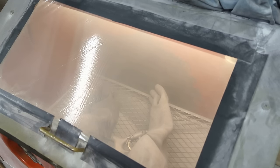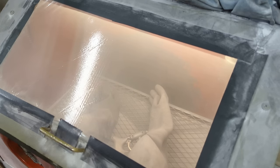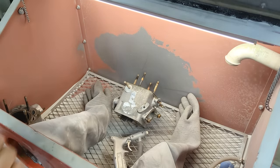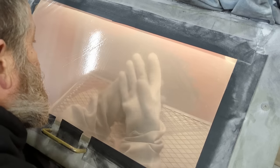After parts washing, I wash them with water. I'm fortunate enough to have a bathroom in my shop so I just go to my laundry sink and rinse everything off. It's best to rinse the parts washing solvent off all your parts — it can leave a residue and cause issues. I rinse everything with water and then dry everything thoroughly, especially if I'm going to run parts through the bead blaster, because bead blasting does not like water at all — it gets clumpy.